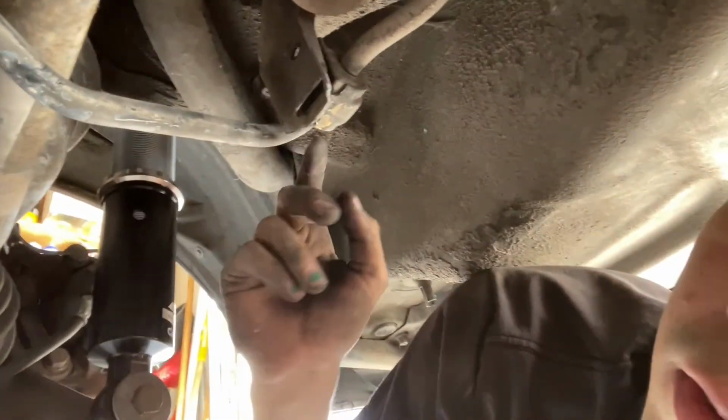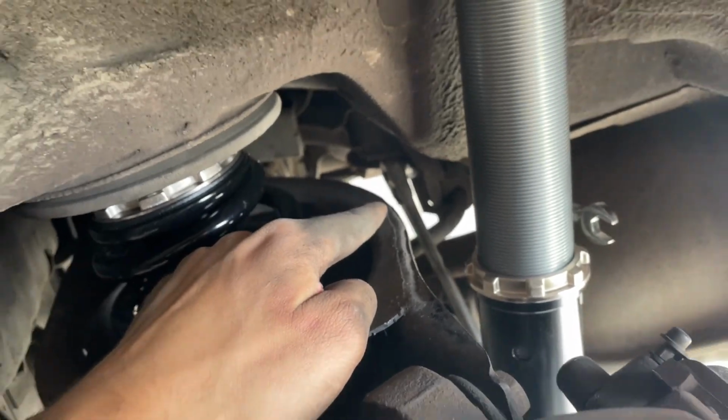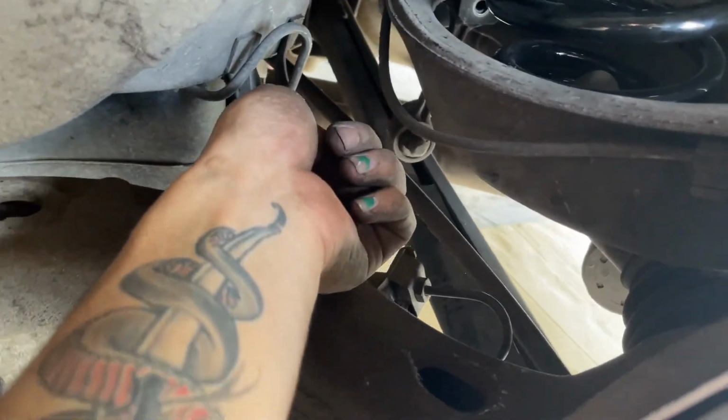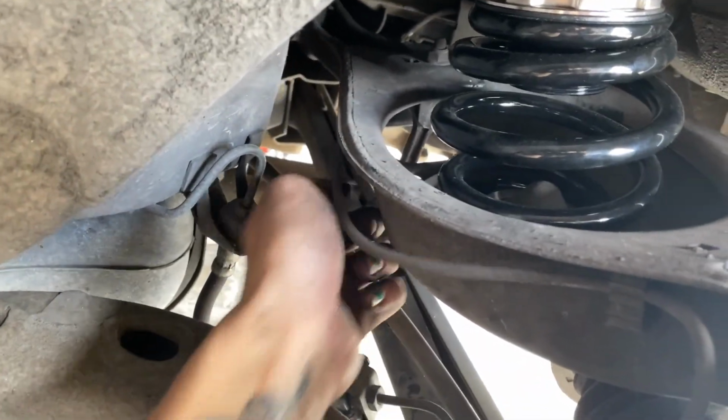After you just pull it off this part where it's hooked up in here, it's your sway bar, and then it looks like it's gonna come out. But after that, we're gonna loosen up the supports to our diff so that this guy can stop touching, give us some space to wiggle the differential around, and then make it a lot simpler. So just that you guys can see, this is the driver's side. There's the 13 bolt on that side, but right there where that's at, you gotta work from under, because you can't really get anything back. Well, you can, but just hold here, and then the other side, that's where you start going at it, or at least I did.